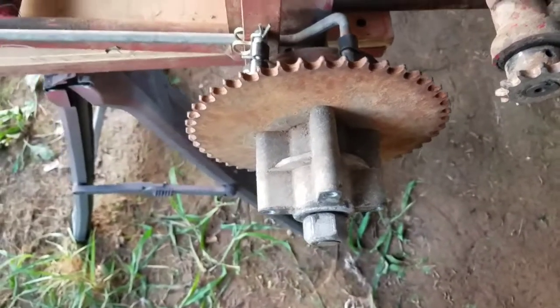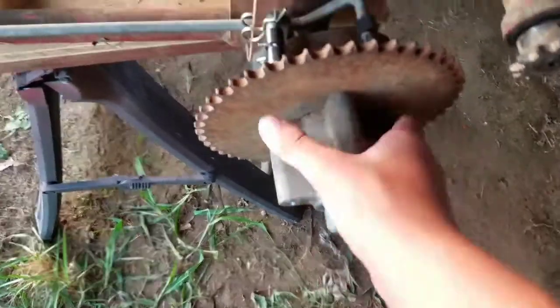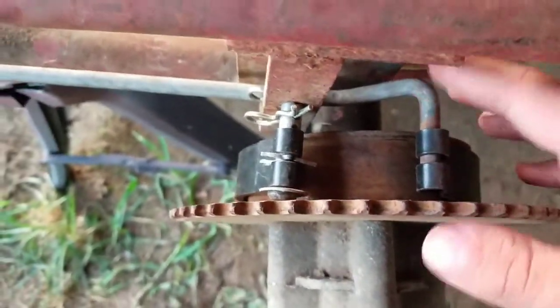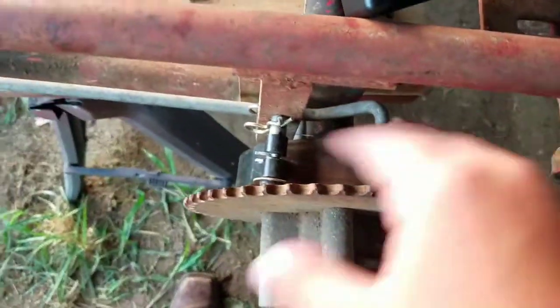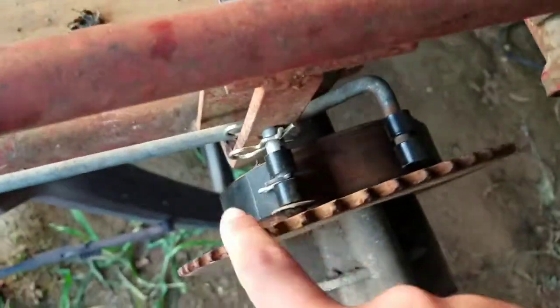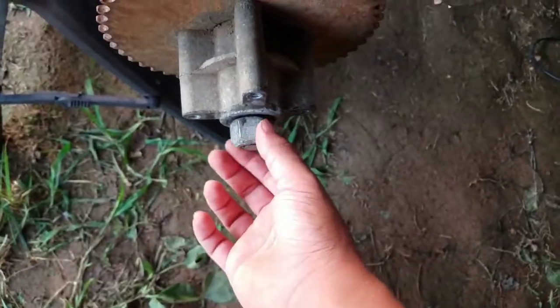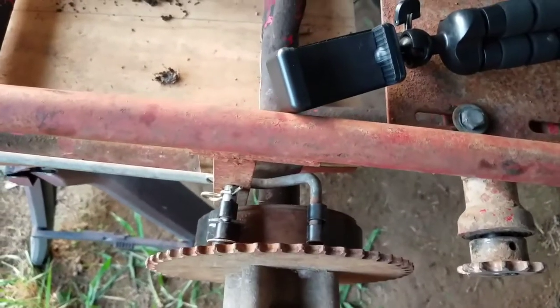Let me give you a quick breakdown of how I put it on. I take the drum and put it back on the axle, and the brake band is connected all the way up to the brake pedal. You push the brake pedal, that pulls the band and creates friction on the drum, stopping the go-kart. There's a little pin through this hole that keeps the brake band in place on this side, and then I put a bolt on the axle so the drum doesn't slide around.